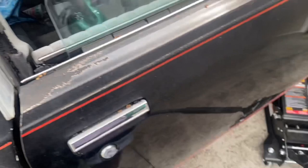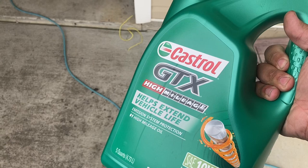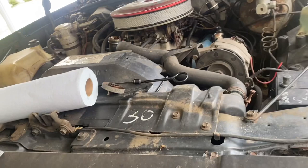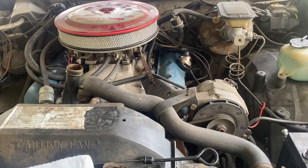The type of oil we're going to be using today is what I prefer — Castrol. We're going to be running the high mileage 10W40, something a little bit thicker. With this being an older engine, as far as I know it has never been rebuilt, so a little thicker oil is not going to hurt. No telling how many miles are on it, with the engine being 51 years old.